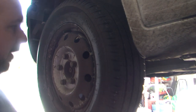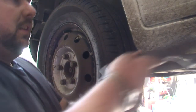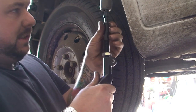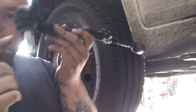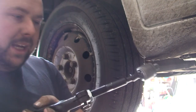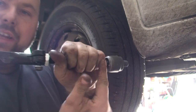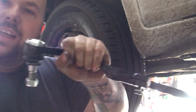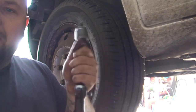The way I basically know — now if you had two people it's a lot easier. If you get someone to rock the wheel and you hold the inner tie rod, it's easier if I showed you. So basically this is the inner tie rod and the track rod end. If someone rocks the wheel, sometimes you can physically see movement in the ball joint. But if you can't see any movement in the ball joint, it's most probably your inner tie rod. Put your hand on it and you'll feel through your hand if there's movement. It is easier with two people. When I did it I felt movement in the inner tie rod.